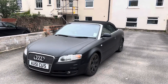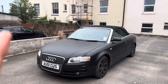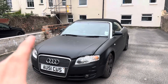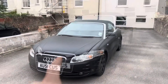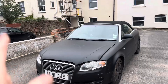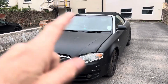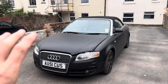The final thing I'm going to say, which will no doubt cause controversy, is that the best way to bleed the air out of the cooling system is to do so when the engine is cold. Most people tell you to bleed with the engine running and up at temperature, but in this case that may not work because of the way the heater core lines are attached to the water pump. The water pump is a centrifugal pump - it creates pressure by spinning - and if you have it spinning while you're trying to bleed the system, you're potentially introducing air into the lower section of the pipe. You want to fill the system up and get all the air out before you turn it on.